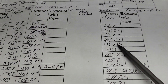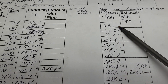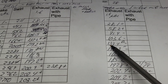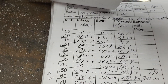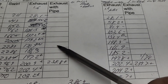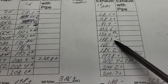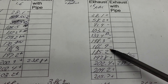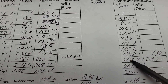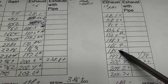On the exhaust: second cut versus third cut. I figured making the bowl a little wider would be a complete win and get rid of the noise we had. It was not a complete win — it was a plus in some areas, minus in this whole section. We still got decent flows, but there's some buffeting at this lift. We've only got noise in two spots at this point, which is better than the three spots we had before. After it got out of this section it was a super quiet port, which I think between 0.400 and 0.600 lift is really good.